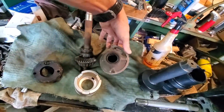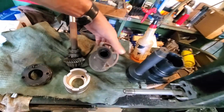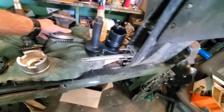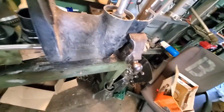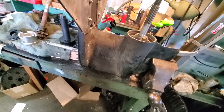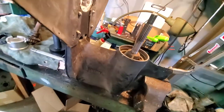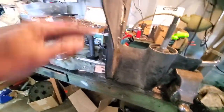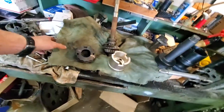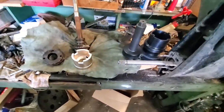Don't try and pull off the sides — make sure you get your puller legs right under these webs. The problem you're gonna have is when this thing has not been opened and greased for a long time, which is very often the case. If you're in fresh water, less so. I'm gonna quickly demonstrate the four most common types of tools available on the market today.